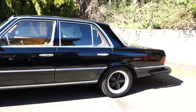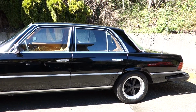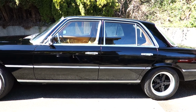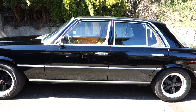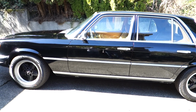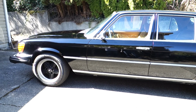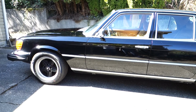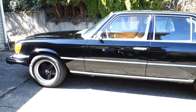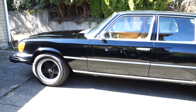Yeah, and I did some research on the actual weight difference between the old M100 6.9 liter and the 4.5 that was in there, and the difference in weight, I believe, was 50 kilograms. When you figure we took out the SLS, there's no SLS stuff in the front, and we took out the air conditioning because that wasn't working, there's not too much of a weight penalty. Just having the simplicity of a standard suspension was very appealing. Plus, it's a short wheelbase car, so it's unique.